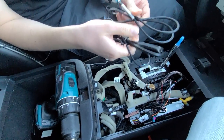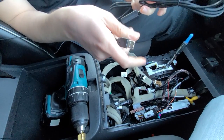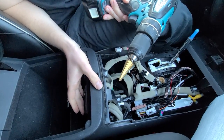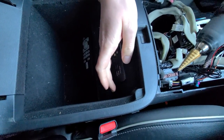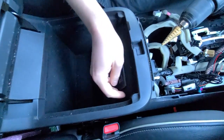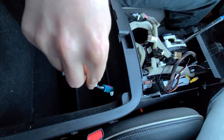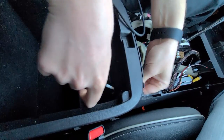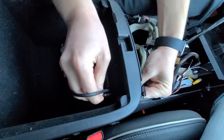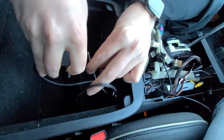Next, we're going to wire two wires to the armrest — one will be for the USB CarPlay or wired Android Auto, and this auxiliary USB for audio. We're going to use our drill and make a hole around this area. You can choose where you decide to do it, but usually around this area is good. With the hole done, we're going to feed first the USB for CarPlay, then the auxiliary. We're going to take our USB-to-auxiliary adapter and plug in the auxiliary here.